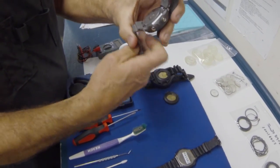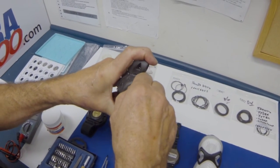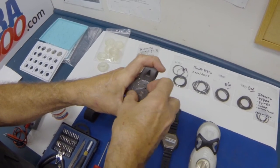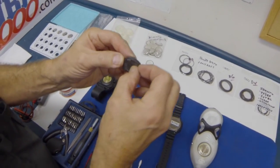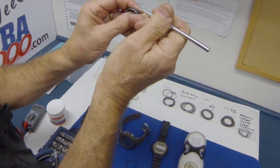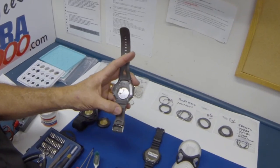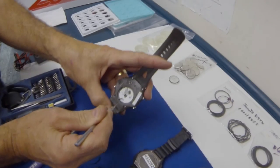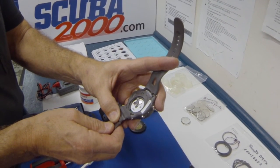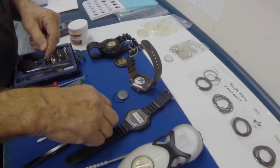A lot of computers have a special door with an open-close mechanism — there's a tool that fits into those two holes. You can grab a couple of screwdrivers or hairpins and force it open, but there's a special tool for doing it properly. Open it, take the lid off — but be very, very careful; you don't use a screwdriver to pry this out. Take the lid off and there's your battery underneath, with an O-ring underneath there. You don't use a pick to pull the O-ring out — a lot of people take something sharp and dig out the O-ring, and as you do that, you scratch the plastic surface and it'll leak. Replace the O-ring, take the battery out — pop the battery out. Now you have to clean all around the surface to make sure the mating surface for the O-ring on the inside is clean as well. Put a new battery in, new battery on the lid, put it all back together properly using the proper tool. Doesn't take long, but done properly it'll work. It's easy and inexpensive to have it done at a local dive store.